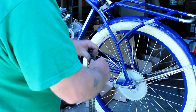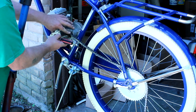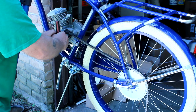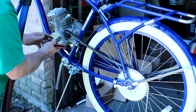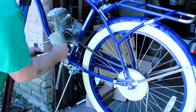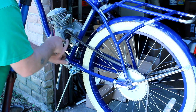Let's go ahead and get the chain on the sprocket. Remember, there's a lot of pinch points there, so be careful not to get your finger pinched. Hold it up against the sprocket here. Now that you're kind of out of the clear, go ahead and pull your chain down a little bit. Make sure it doesn't get caught on this part of the case here.